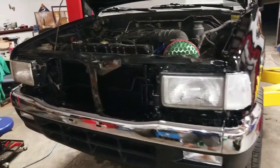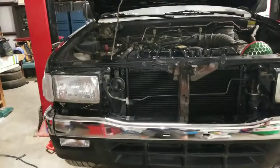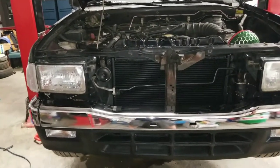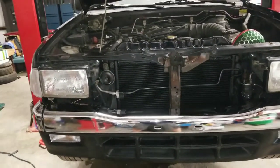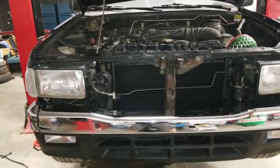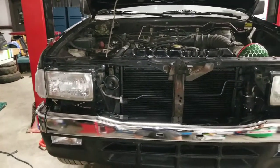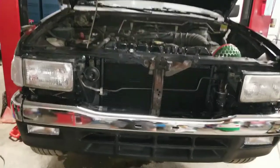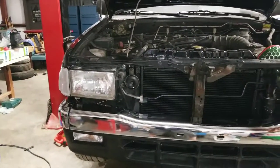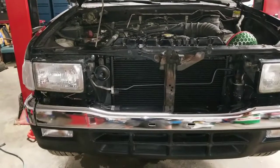I also mentioned in the earlier video that rodeo and pickup parts from the doors forward are going to interchange — that's your exterior parts. On the inside, a lot of the early rodeo interior parts will match the truck up through '95 and a half. At '95 and a half they went to airbags in the rodeo and had to change the dash, while the trucks finished in '95 without ever having airbags, so some interior parts could be different.